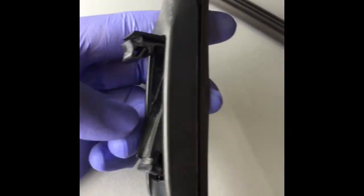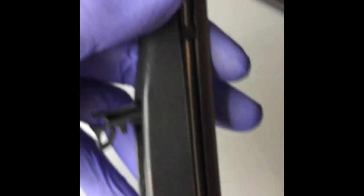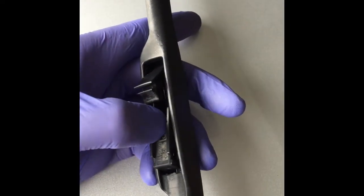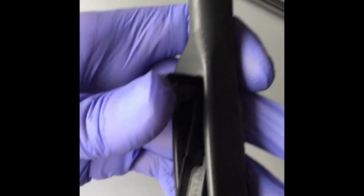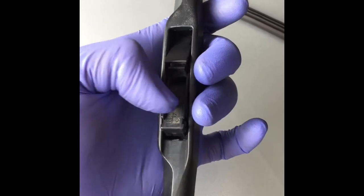Okay. Now the next step is just to put the wiper blade back. I'll flip this up, insert the wiper arm here, let it go in, and then as I showed you, the wiper arm has a U shape, which will snap in here. So first of all, you push it like this and then pull it up. And once it's properly in place, you lock this from here.